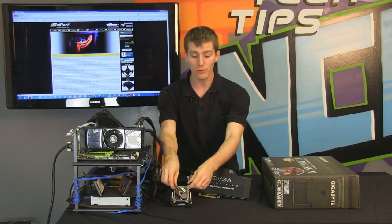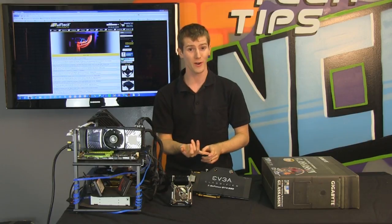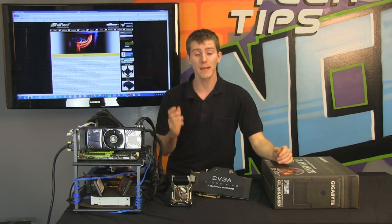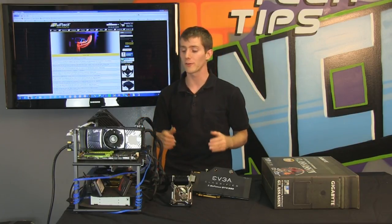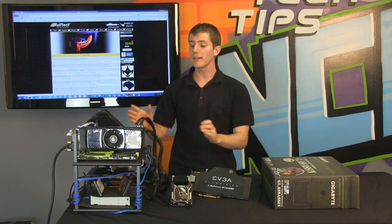If you don't do your due diligence ahead of time, you're pretty much guaranteed to run into a dead video card or a dead stick of RAM, a dead motherboard, which is going to cause you to have to tear apart your entire painstakingly built water cooling system in order to get that one part out, change the whole thing, and put it all back together. So that's the reason why I always recommend running on a test bench.